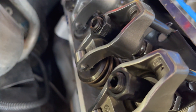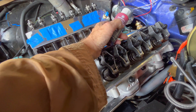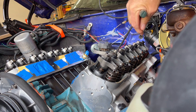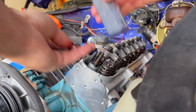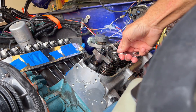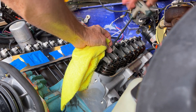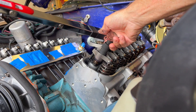That's way better than what we had before. After doing six of eight cylinders I realized I was supposed to be adding assembly lube below the push rod, the roller tip, and also the pivot ball. This is the lifter preload. I'm locking down the poly locks at 20 foot-pounds. I tried to use a little less silicone — this is take two, I went crazy the first time.